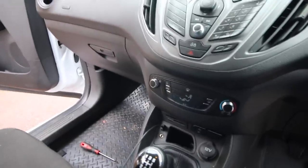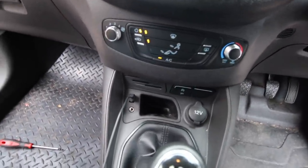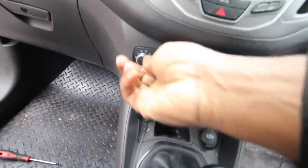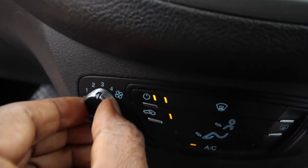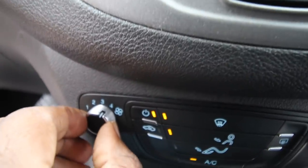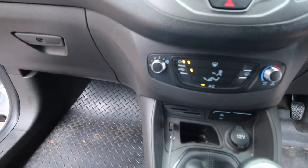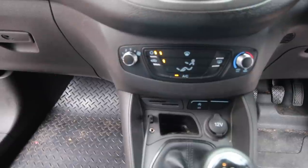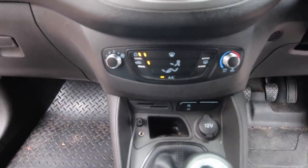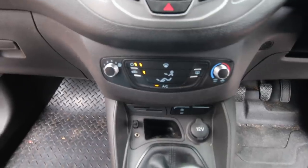Let's get back to the Ford Courier and look at the issue with the fan. This is a very common issue on Ford vehicles in general. When you go to the fan, you can see that on speeds one, two, or three nothing happens — until you get to four, then you get full speed. What causes this is a little resistor — the fan regulator, or fan speed controller. It sits inside the main airflow, and we're going to take a look, get it off, and see if we can fix it.